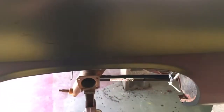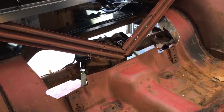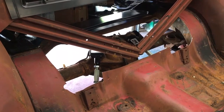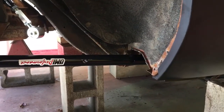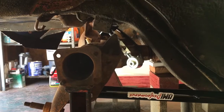The inner and outer wheel well houses, which we'll have to cut out of the car. The other thing I'd mention is I've been working on the four-link setup. I cut the floor out so I wouldn't have to sit under the car — one of the great advantages when you're going to replace all sheet metal. This is looking pretty good right now. Just for mock-up purposes, these are stock length lower control arms bolted to the stock leaf spring mounting point, and this is ride height probably at its lowest in the car.